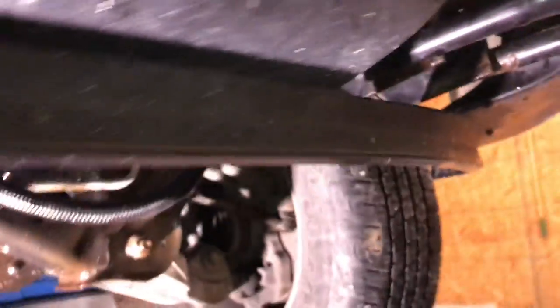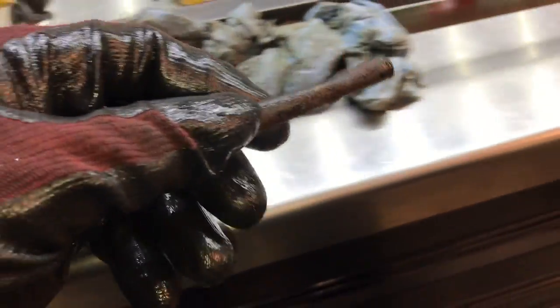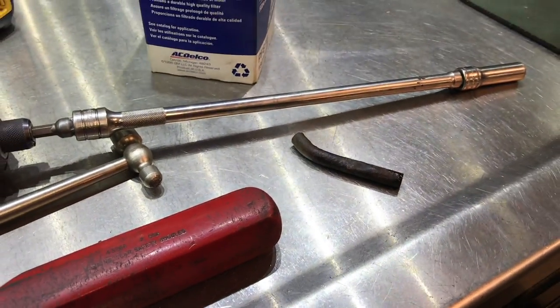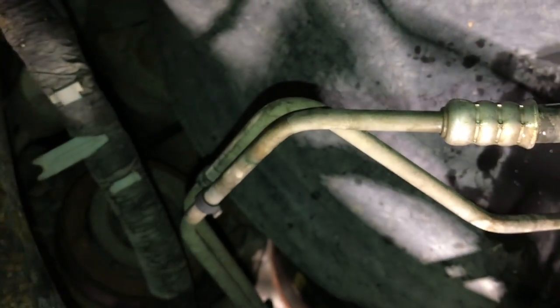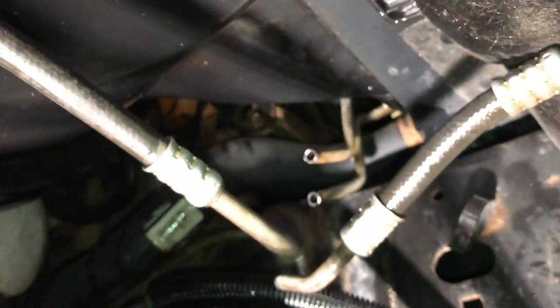It's going to be less frustrating — I don't have to fight these cooler fittings, which are a real pain to get off even with the right tool on older vehicles like this. I went ahead and did the other one while I was at it; as you can see it was about to rust through as well — the pipe was really weak so I cut it off. Interestingly, the only place these cooler lines were rusting badly was where they were secured in this little retainer. The retainer traps moisture, salt, and road grime, and rusts out the line. The rest of the lines are perfectly fine — no rust anywhere — it's just where they were trapped in this retainer.